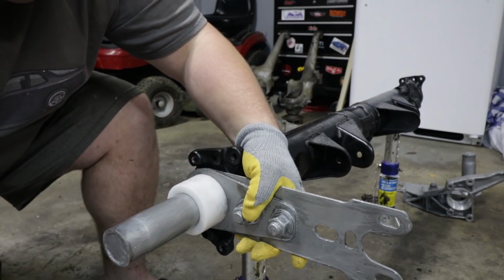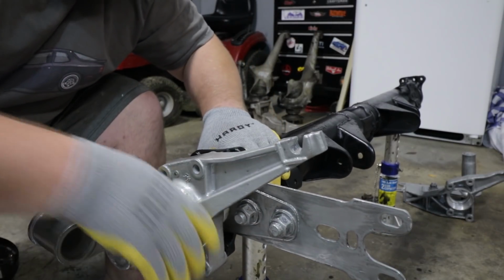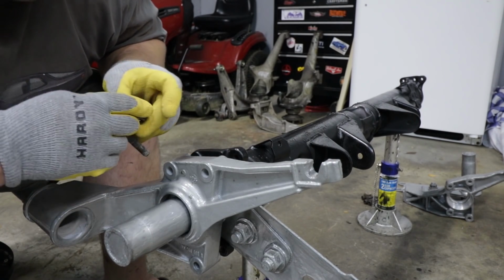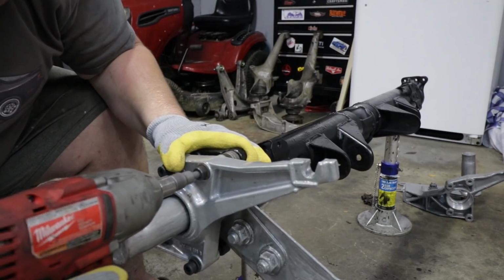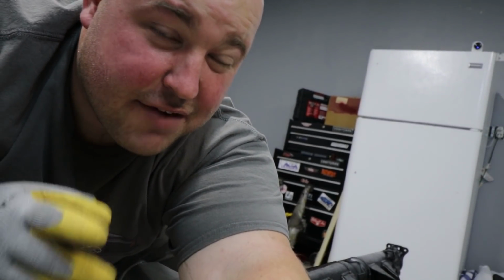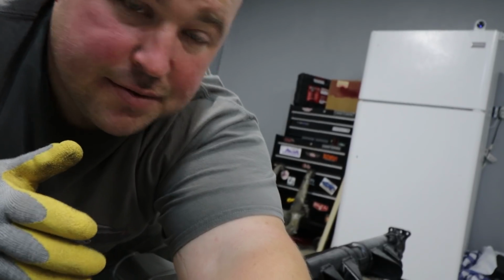So then, you're supposed to very quickly bolt this stuff together. It's gonna be difficult because that bushing has expanded. We're gonna have to draw it in with the bolts. I'm gonna do the other side real quick, and then we're supposed to let everything cool down, take them apart, grease them, and make sure there's good range of motion.